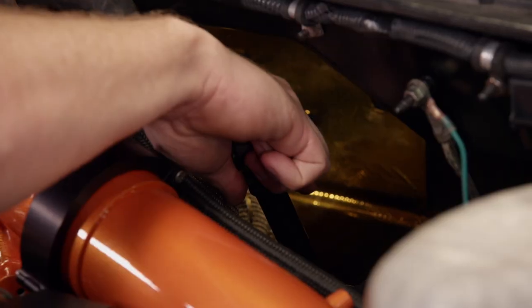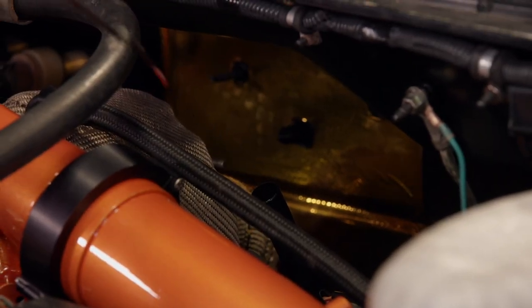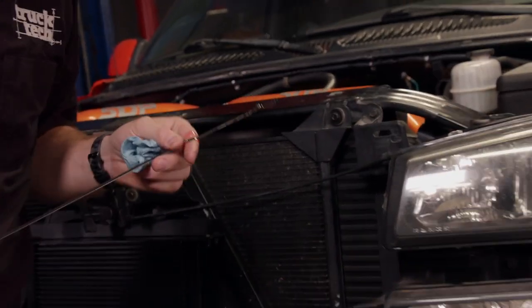Overall, I'm pretty happy — it's sounding good. It took a minute for the motor to crank up just because this is a fresh build and there's air in the fuel system. The power steering's winding just a little bit, but it's probably low on fluid. We'll have to check the coolant and everything else, but overall we're in good shape. On an automatic transmission, you have to check the fluid with the truck running — right in the middle of the notches.